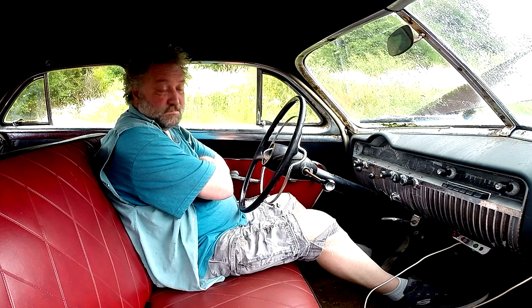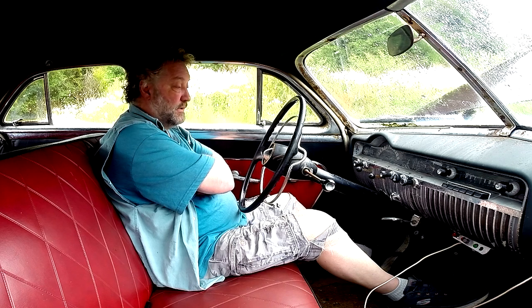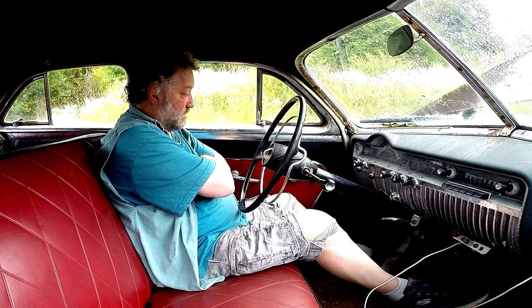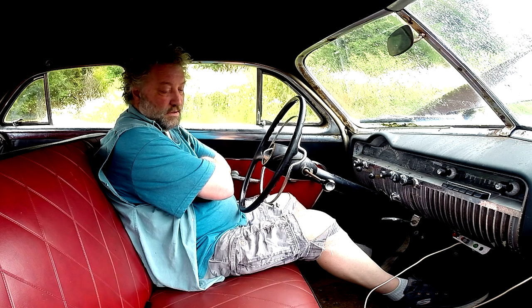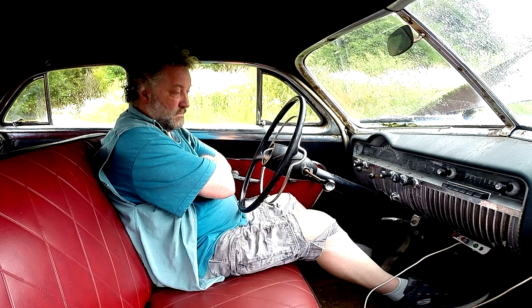Pleased that the points replacement thing is working fine, and pleased that we made the right call on the ignition wire that wires into the distributor. I had a relatively good idea of which one it was using a voltmeter, and when Kara was switching the thing on I could see the values changing. So pretty good on that — the Merc at least lives to ride again.